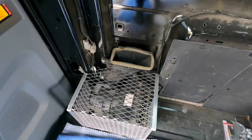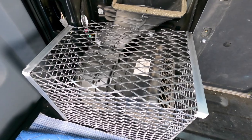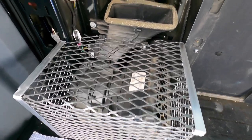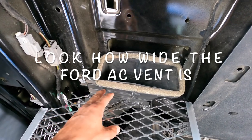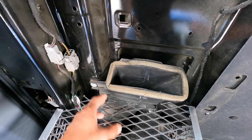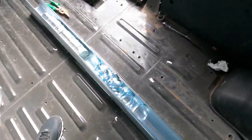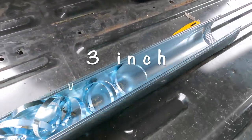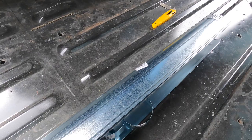Now that we've got the cage built around the van's pre-existing AC unit and ripped out the old venting, we're gonna have to reroute these lines so we can get the AC flowing through the van again. We're going to use three-inch pipe and then three-inch hose. For the three-inch pipe, you close it and clip it together to create the connection.